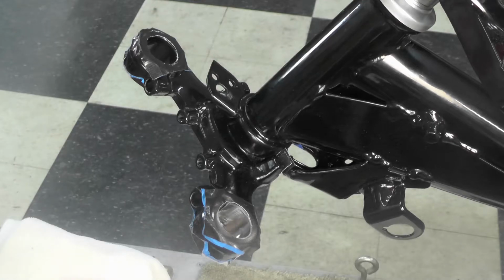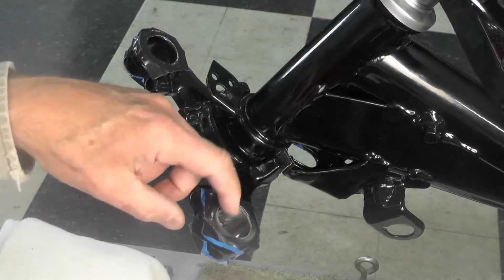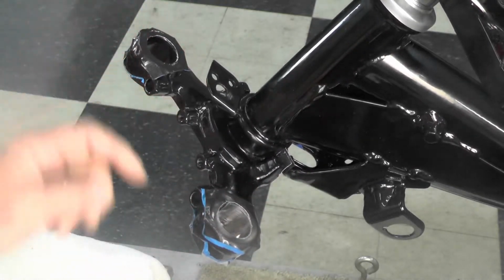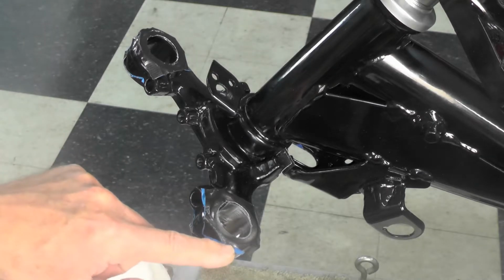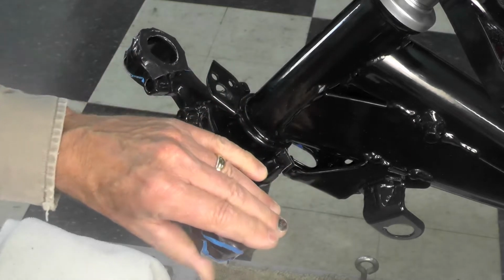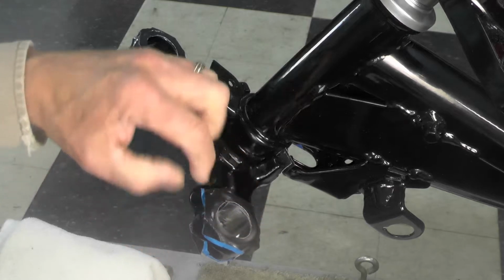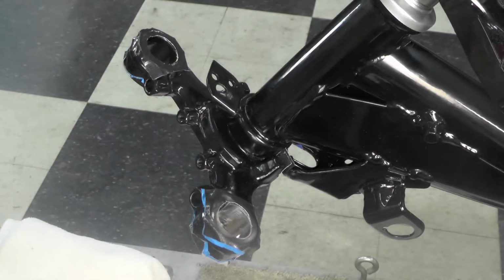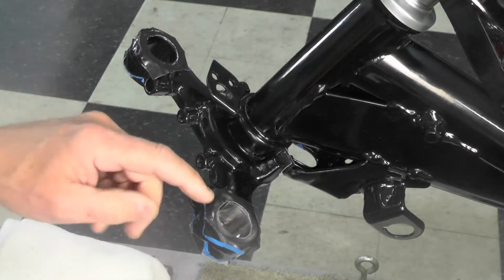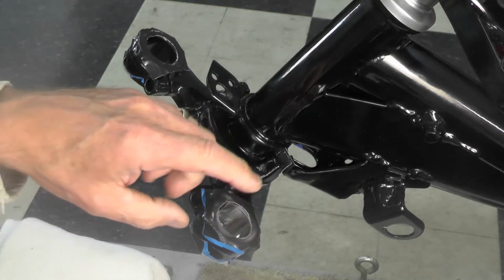Before I did that, I did a test run on this tube right here, you can see the powder's already removed. On both the top and the bottom surface here, I put a layer of masking tape, that's the blue. Then on top of that, I put some very heavy, very aggressive duct tape. The reason I did that is to protect this surface, because inevitably, whatever method you use running your tool up and down, you will damage or nick that paint if you're not careful.